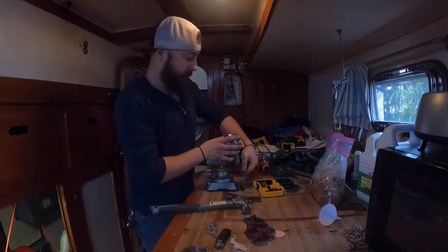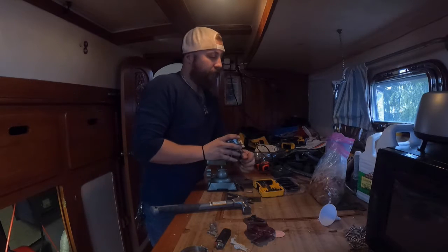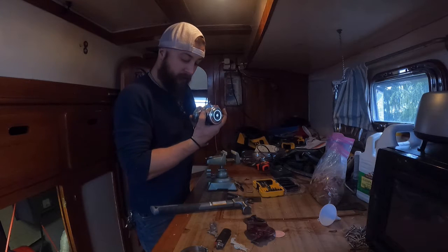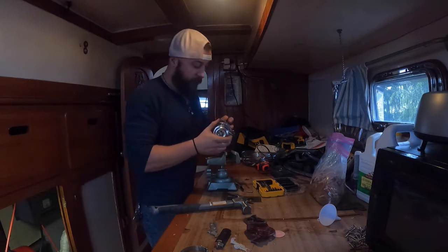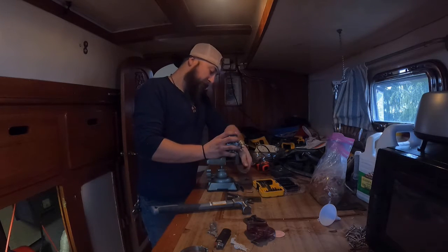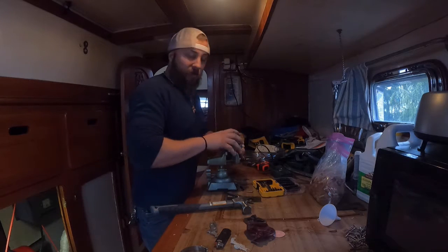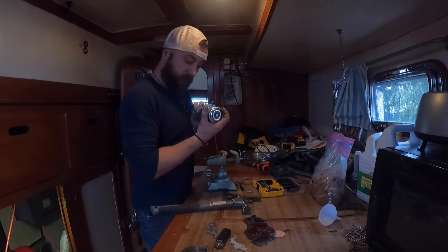The one thing you've got to be careful about is one sloppy hit and smacking that seal surface. These pumps are pretty straightforward and simple, so you don't have to be super gentle with them honestly. But if you smack this little aluminum surface and ding it up, it won't seal and you'll be leaking all over the place. So just using the cloth side to kind of get in there — and this looks like it's just starting to go.